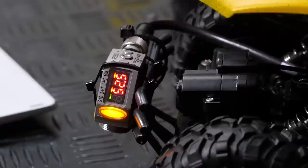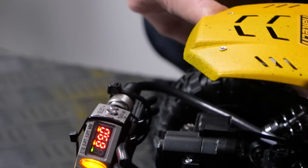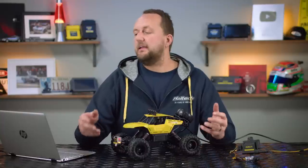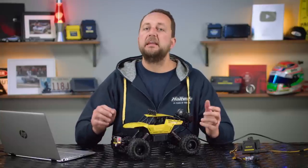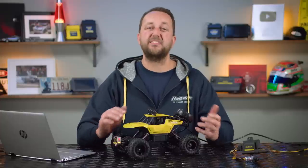The laser ride height sensor is wired into an analogue input on the engine management system and displays its measurement in millimetres or inches. We configure the software so that we allow the front to lift higher at the beginning of the race, then tighten the allowable height by the end of the run, making racing as safe as possible. There's also a function that allows us to hold the cut for a programmable amount of time once the cut event has occurred, to stop the car riding the cut — meaning it hovers at the cut percentage height, essentially reducing engine power the entire run.